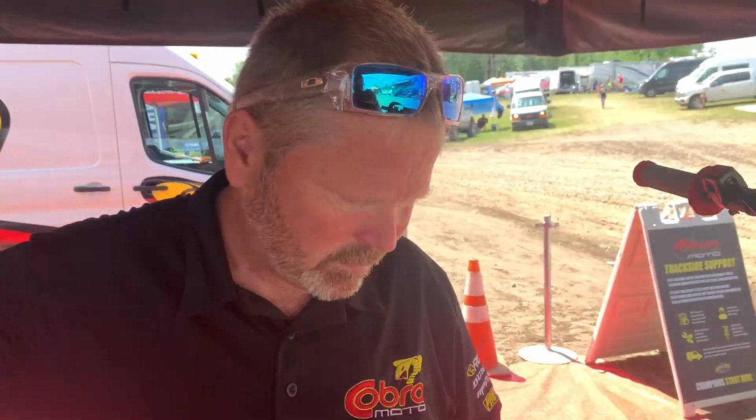So if we ran this bike with a 40 base gasket, with squish at 44, so the squish was at 60. If we ran this bike at squish with 44, what would happen? You're probably going to get some detonation in the piston, no matter if you're running C50 or not. That tight, it's too tight. Yep, compression's too high.